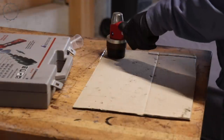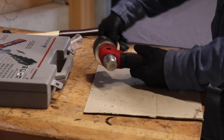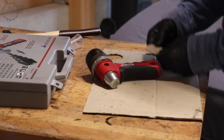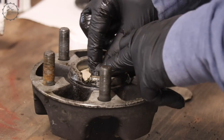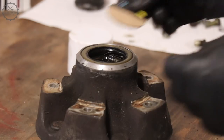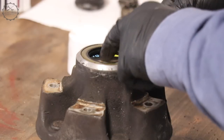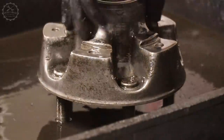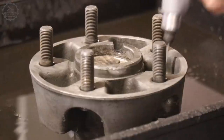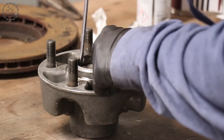The bearings are good, but I wanted some of the dirt on the wheel carrier to go away, and so I had to avoid that loads of dust and brake cleaner go into the bearing. I've seen pictures on the web of guys who make this part look like a piece of jewelry, and under normal circumstances I would have done that too. But all kinds of blasting and heavy wire wheeling require the bearing to go out and springs around the corner. So for once, I decided to accept to not restore this like a maniac, but like a normal, friendly person.